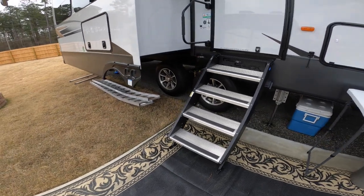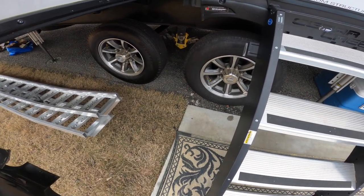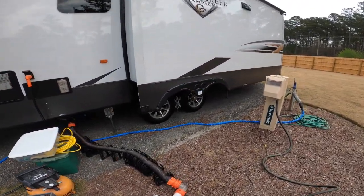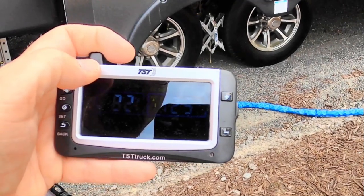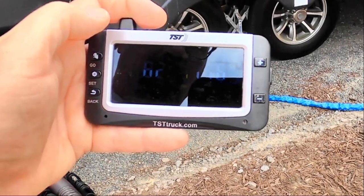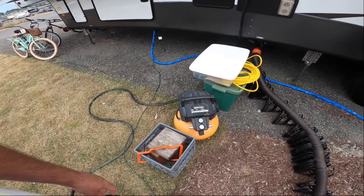One small issue — the tires are located where I've got the steps in the way and the slide. Luckily these two tires are at 123 and 124, so I'll leave them there. Same issue on the other side with the slide out, but we'll do it. The front tire is at 125, so we'll let a little bit of air out. The back tire is at 116, so we'll try to add some air to that one. I'm just gonna use my little pancake compressor — it says it'll get up to 150 psi. Most cars only take around 35 pounds, my truck takes 80, but I've never come close to 123 pounds.